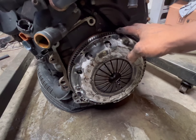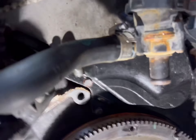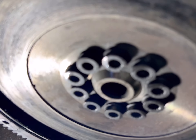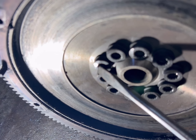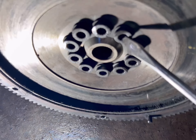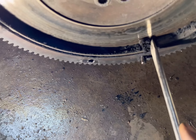I'm hoping it's just not dip fluid. I'm gonna pop this off and put it on the engine stand. We're gonna get the top and bottom half off. You can see something was dancing around in here - look at the edge, along these edges it shaved down. Something was bouncing around in here, you can definitely tell because your pressure plate isn't supposed to be like this.